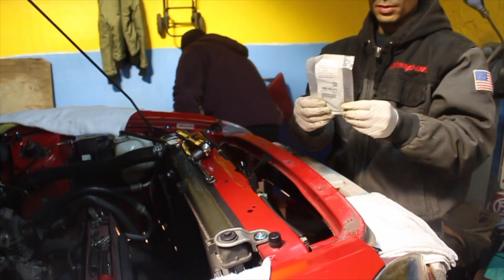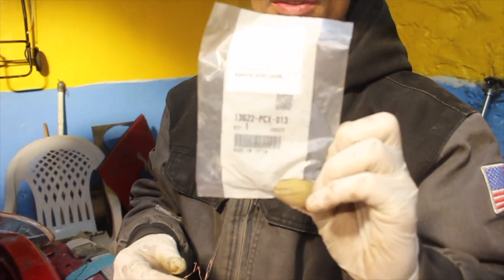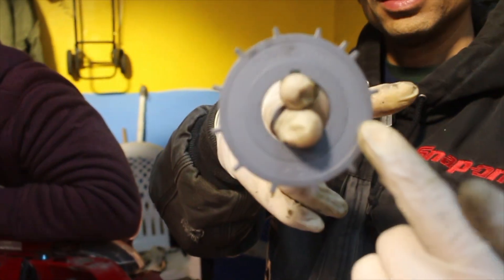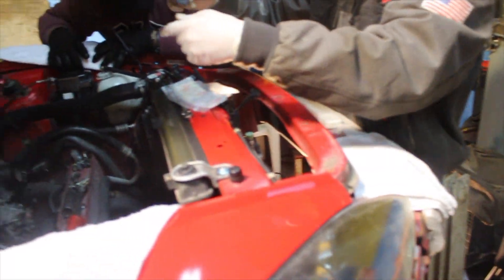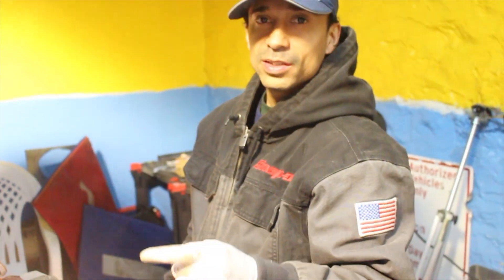The timing cover is off, now we gotta take that apart and get to the pulse plate. This is the pulse plate that we have to replace when you're doing the Hondata KPro. This is the AP2 pulse plate going on the AP1. It says do not make an error with this installation - outside has to point outside towards the bumper, outside has to face the front end of the car. There we go, a little tricky but just make sure it says outside. We gotta take the valve cover off - the second pulse plate is on the exhaust cam, so you have to remove the valve cover and it's by the firewall.